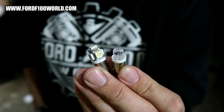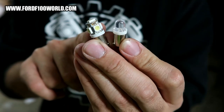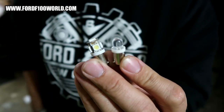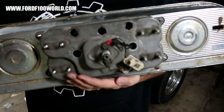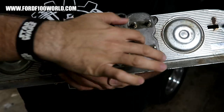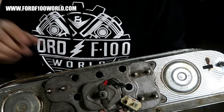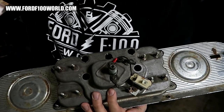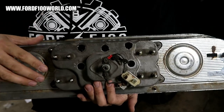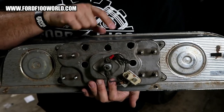This type I used for my high beams and my signal and it worked really well. I'm basically upgrading to these to light up my gauges, and I plan on going with these for the signal as well. It actually tells you right here what wires — orange and black with white stripes. It tells you here as well. You won't have that issue with the circuit board style. These two holes run the lights so they light up all of the instruments. Up here, these two are the signals, and this one right here would be your high beams.